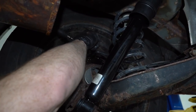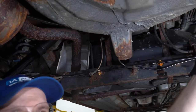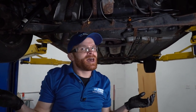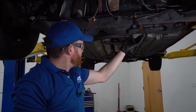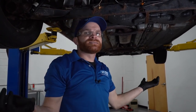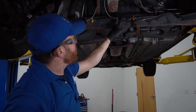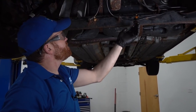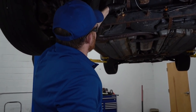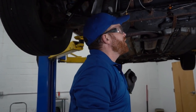Now, since I'm going to be having to replace this line right here, obviously, I want to double check every other line. I'm going to go over here, double check that line, and make my way all the way across, just in case I might have missed things. It's common if you're walking along, maybe you look down for a second, maybe you don't see one of the bracket areas that the line sits into, and it could even be just a very small area, like on this one right here, where it looks as though the whole line's coated, it looks amazing like I was saying before, and then you find one area that's just a half an inch or maybe even a quarter inch, or even two areas that are just unsafe. If that's the case, you need to make sure that you replace those lines as well.